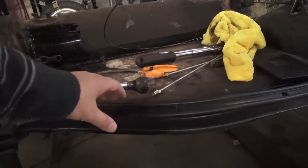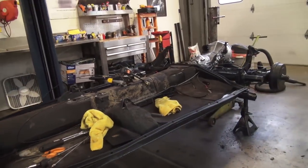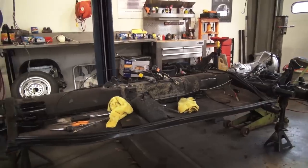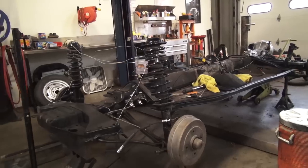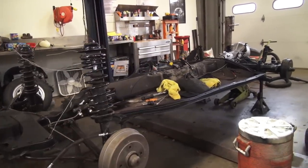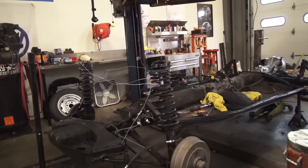You can also reseal the chassis, which is what we're doing — I've showed videos on this before. Just easy access to everything from the tranny, torsion arms, things like that to get your chassis up into good shape. When I restore my cars, I like to do it once and do it right the first time. So why not do a body-off instead of hassling with it later when the shell's on the chassis. What you see here is a Super Beetle chassis.